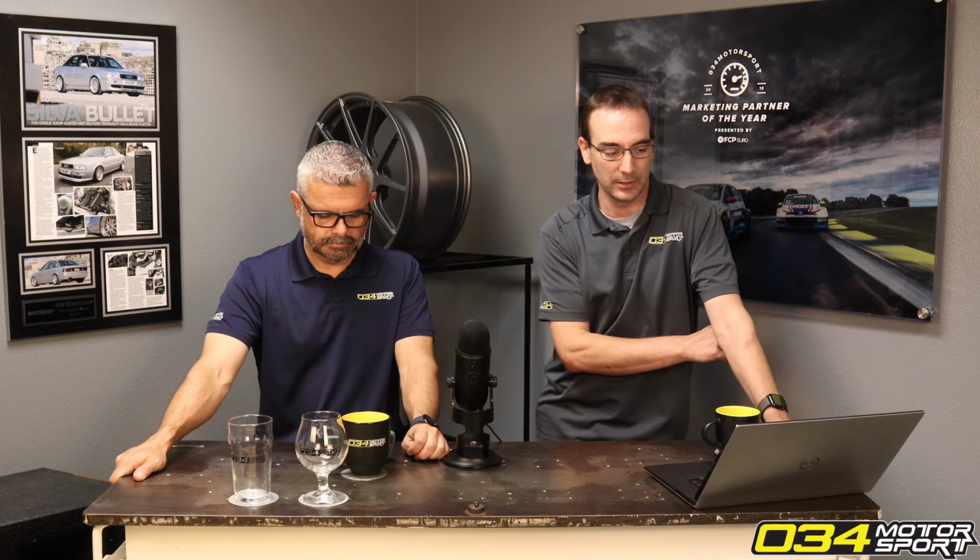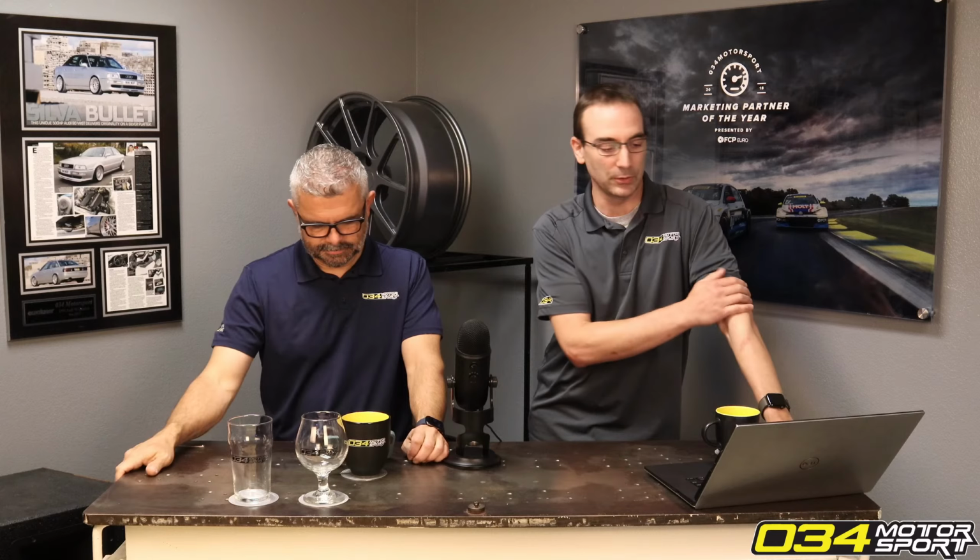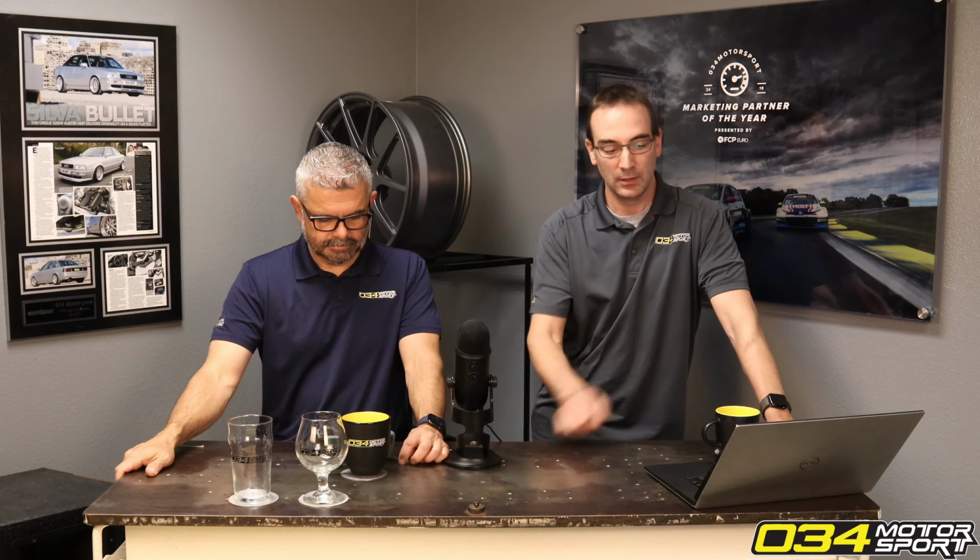Reactively. And unfortunately, that's the way a lot of calibrations on the market work. They don't expand those tables. They don't properly report the amount of torque coming from the ECU. So the transmission is then left to try and do everything it can kind of backwards, where it only knows what it has to do after the fact.